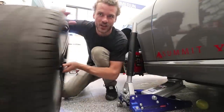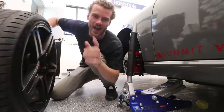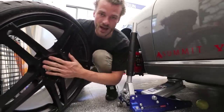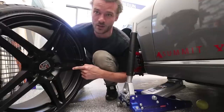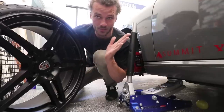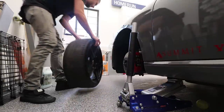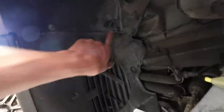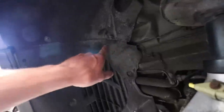By the way, these tires are completely shot — you can see some cord action going on. These wheels are for sale in Utah if anyone is interested. They fit 911s, Caymans, and Boxsters probably — they're Roderick RW5s, I believe, 19 inches. Shoot us a message if interested. The wheel is now off and you can see the wheel liner here — it's two pieces. The cord is directly behind here, so I'm going to undo these bolts to pull the fender liner back and reach the cable. These are T25 Torx.